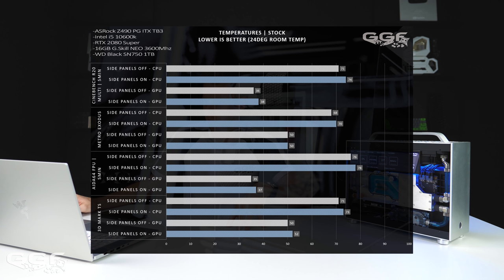As you can see, when the system starts at full speed the pumps are very, very noisy. You may find that a lot of motherboards' BIOS can't go below 60% for controlling your fans. I couldn't go below that, so I had to install the ASRock software which allows me to go as low as I need. I found at 60% the pumps were still a little bit too noisy, but as soon as I went down to around 50%, it was pretty much silent - you really can't hear the pumps.